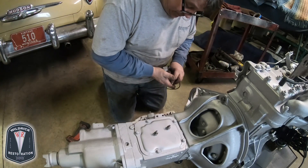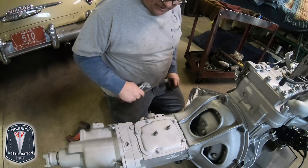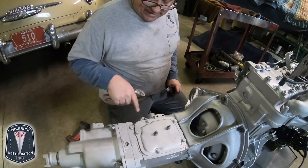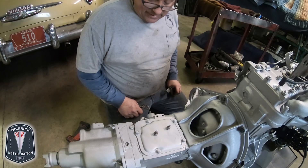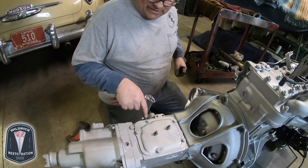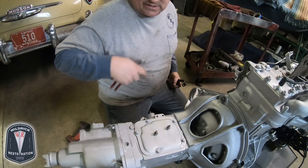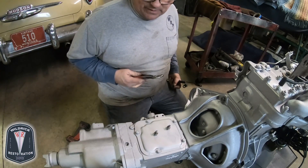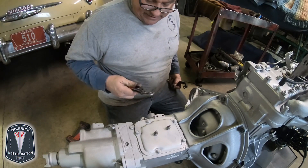Something you should do is verify, because the shaft is vertical and it's underneath the vehicle. It's not uncommon to find that shaft is a little sticky or sometimes it's just frozen up. That will obviously, even if the cable is connected to it, if the shaft inside the transmission is frozen up, it cannot move the shift gate lever inside the transmission. That will limit your travel of how much you're going to be able to shift and cause all kinds of adjustment problems, which we'll talk about in another video.